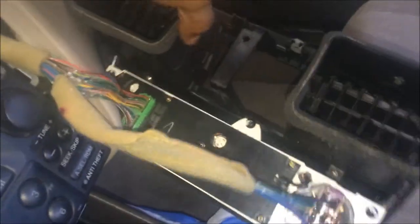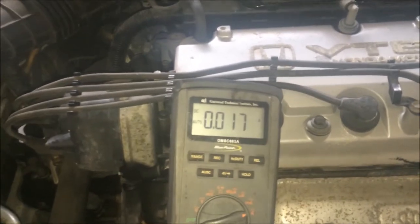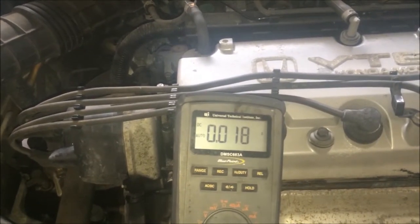How ironic is that? I'm going to go straight for this one because, judging from the magnitude of wires going to the thing, that's the computer portion of it. I'm not actually going to unhook the blower switch — my hunch is there and I'm going to stick with it. Unhook that. You probably want to be a little more careful than I am being here, because scratches occur easily on interior parts. Unhooked. Let's see what we have for our readout. Proof in the pudding, ladies and gentlemen — that was our issue. That was drawing the battery, and now we've settled in to just under 20 milliamps at 0.017, with 0.020 being the maximum.